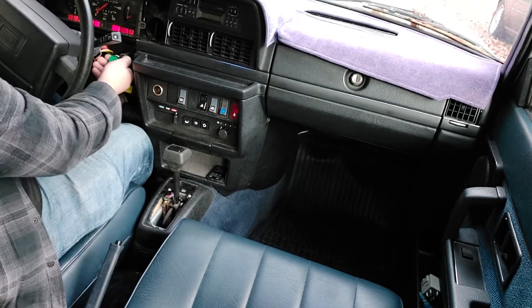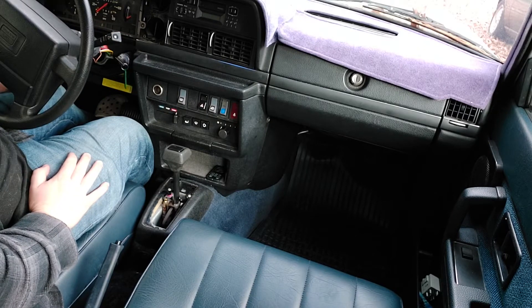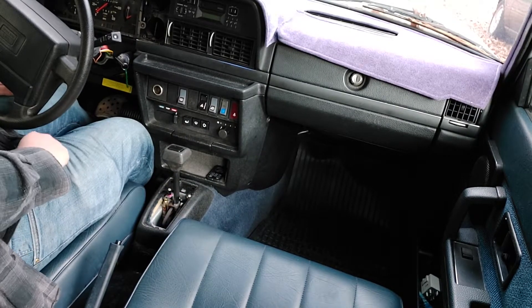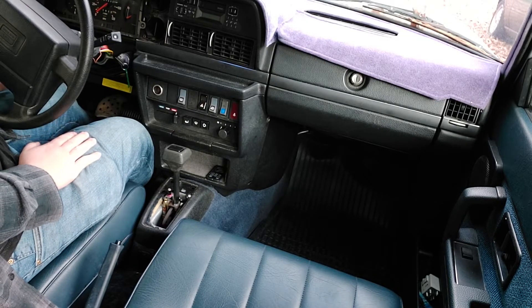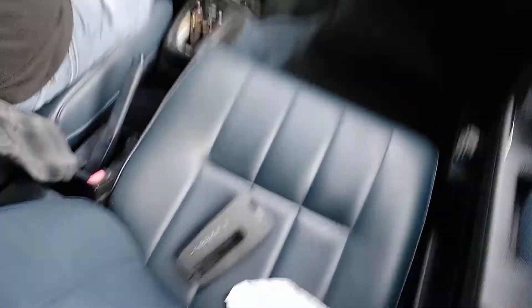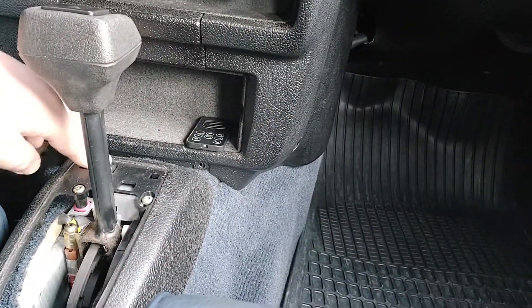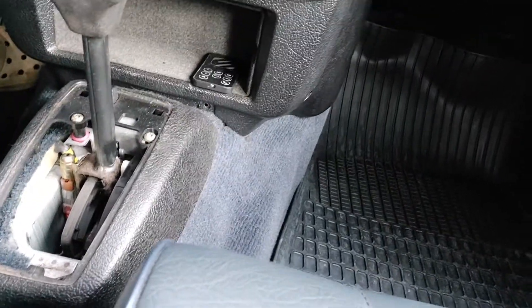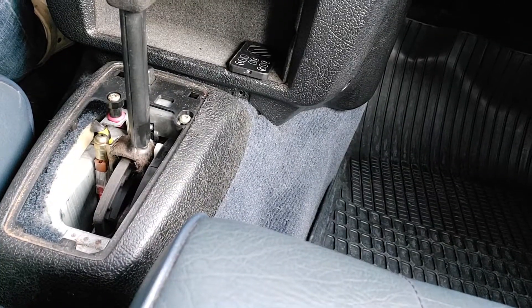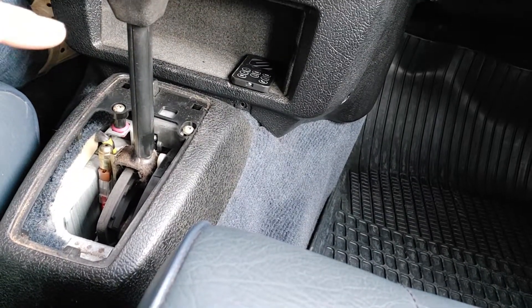Problem: put the key in, issue — no start. Sometimes in a 240, if you can't get it to start, it's got something to do with your shift lever. Not always, but in this situation the car has a shift lever that's out of adjustment. If you come in here you can see there's a lot of mechanism — shift lock functions in there, lots of different components. The problem is when you move the lever back and forth, the ignition, when you give it the signal to start, has to pass through a switch that's in park or neutral — the neutral safety switch.